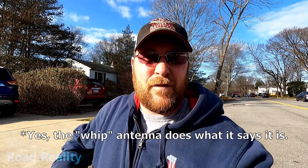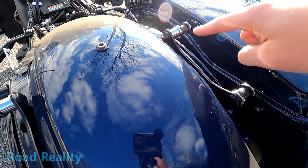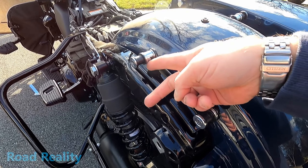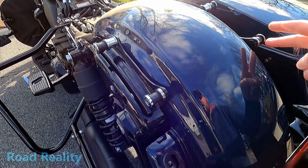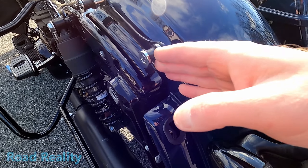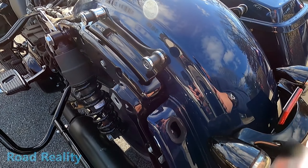The other pain in the butt was actually getting the tour pack to connect to the quick-release hardware. It's got four points for docking — the front forks in like this, it's got rubber pieces on it. The back didn't quite line up side to side, so you kind of have to jimmy it back and forth to get it to pop into place, and then it clicks. But once it's in there, it ain't going anywhere. So that's pretty much what was a pain in the butt on this install. I ain't too bright but I figured it out. While we have the tour pack off, I can show you some of its features — let me put the bike back together and we'll take a look inside the tour pack.